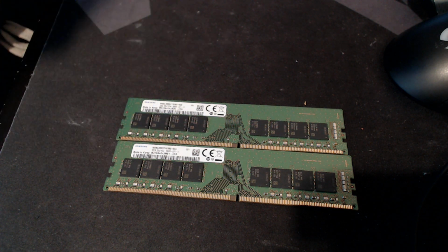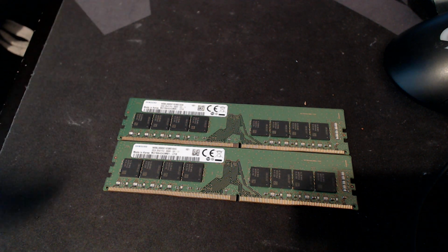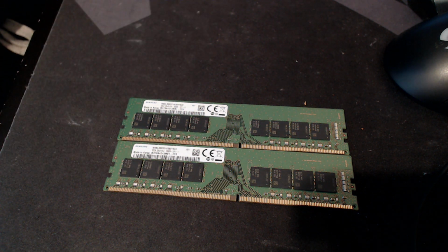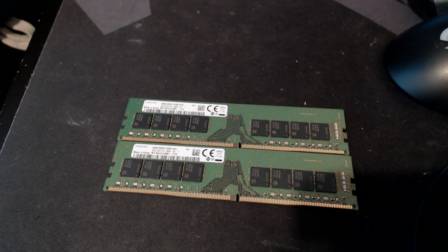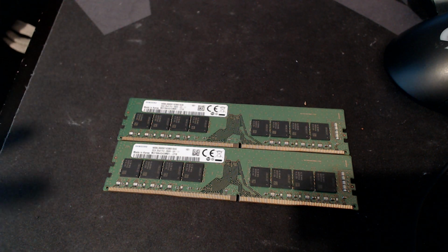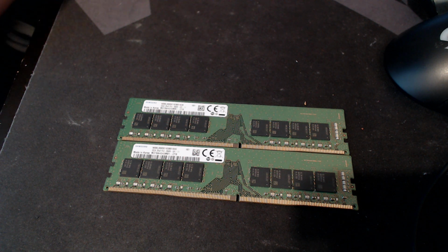And they are unregistered, so you can just install them in anything. That's the cool thing, because I know servers have had 32 gig DIMMs for ages, but these are the first 32 gig DIMMs that at least I'm aware of that you can just stick into a Coffee Lake system, like a daily system, right? So I'm also going to be testing these on Ryzen, probably with one of the MSI boards. I don't even know if they have BIOSes updated to support these 32 gig sticks yet. But,